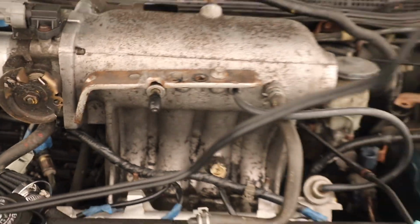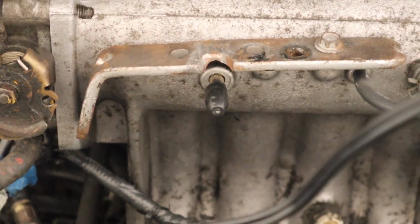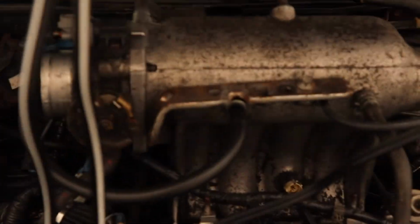So pretty much on a stock CRV, which this engine comes from, this goes in there, this goes there, and I believe this gets plugged. We're gonna see if that works. I'm not sure if it's going to or not. If that doesn't work, I need to find out what that one thing I capped goes to, and that could be the reason I'm having idling issues. 99% sure one of those things is supposed to go into the canister, so I made a little bit of a line right here to go into the canister, and hopefully my problems are fixed so I can start it.